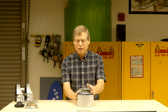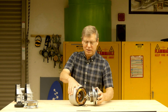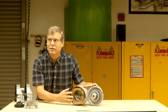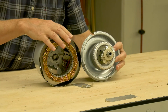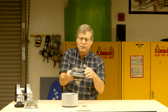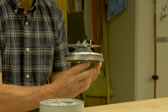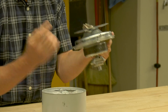Now we're going to look at the motor that powers this garbage disposal. The can has already been pried apart so we can pull it out like this. The motor has two main parts: the stator — the stationary part — which has all the windings for the electromagnet, and the rotor, which is connected directly to the rotating plate with the paddle wheels on it. This is a very heavy piece of magnetizable rotor metal and it serves two purposes: it also serves as a flywheel. Because it's heavy and massive, small pieces of food can't stop it — it's harder to jam because all this mass keeps it spinning.